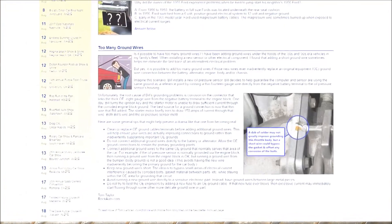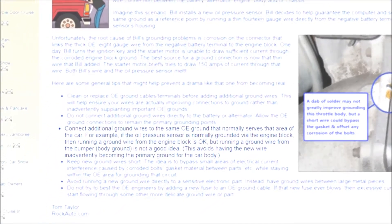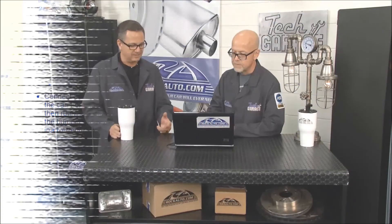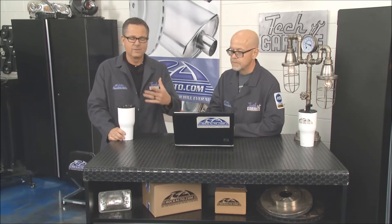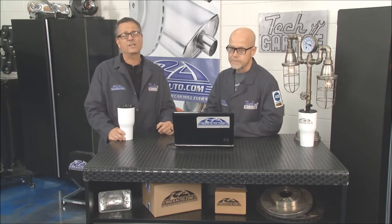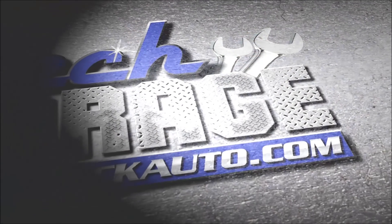Can you pull up one of those newsletters? Sure — everything's on there. OE ground cables — you just highlighted an awesome part. You want to keep the component grounded in the section of the engine compartment where it was originally grounded. Good wiring practices — the wire's got to be the right size, it can't be too long, it can't run through your heat source. We deal with that every day at rockauto.com and here at Tech Garage. We're going to take a short break, but stick around — we'll be back with the video question of the week as soon as we return with more Tech Garage presented by rockauto.com.